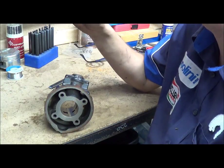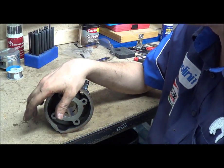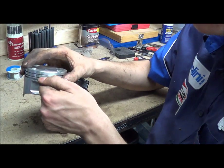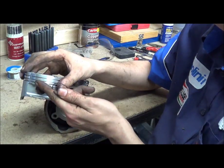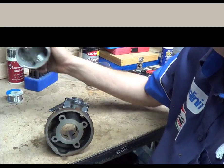There are a lot of pictures on the internet of people who've got exactly that problem — you'll see that the ring travels outside of the ring groove and it'll break away from the piston. You'll see like a sweep in action of where it's eaten into the piston.